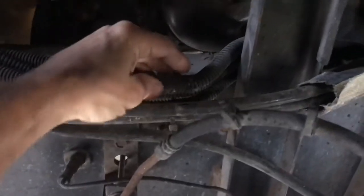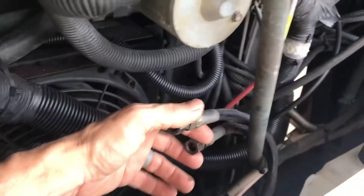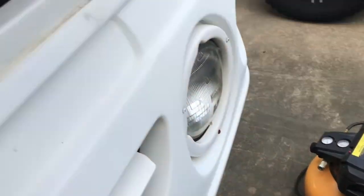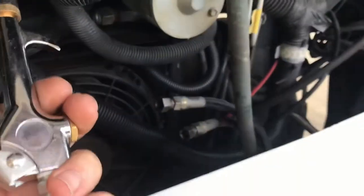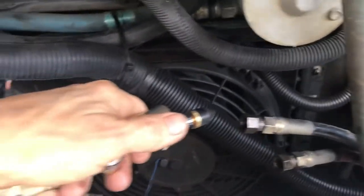I'm going to show you another shot of that heat shield. This is where it comes up by the front tire — we got the motor there and the header and the heat shield. It's a sleeve that the hose just runs through. So I'm going to put all this back together and fish that through there. I'm still cutting these straps — these straps hold a lot of wires and everything, so make sure you put it all back. And my pump's right there. I got all the tie straps broke loose. These are my two lines going to the back. I've got my little air compressor there, set for about 15 pounds. I'm going to blow a little air through there so when I pull it, I don't get fluid all over the place.